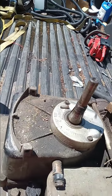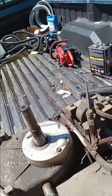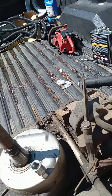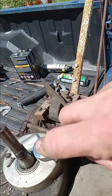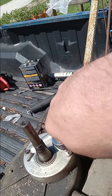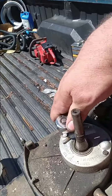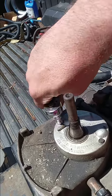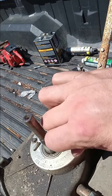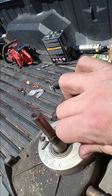And there's our points cover right there. We'll tear the cover off of that. And then we'll get in here and take a look at our points and our condenser. But I'm pretty sure they're either shot or corroded up, and that's why we don't have no spark. We might get lucky and get in here with our points file, clean them up, and get them going. Let me get this cover off and we'll come back.